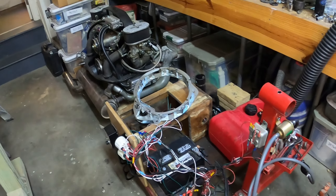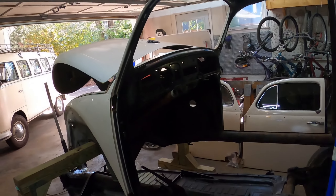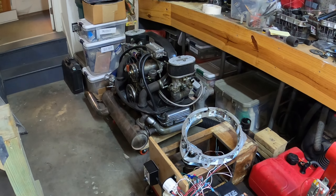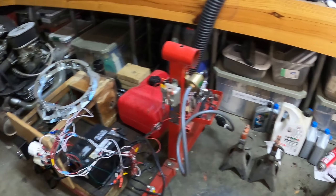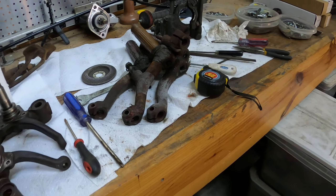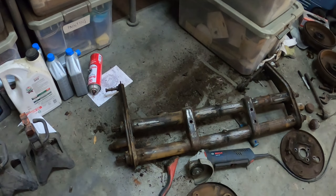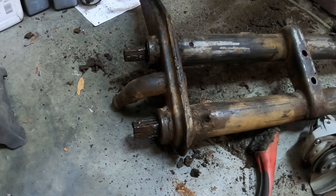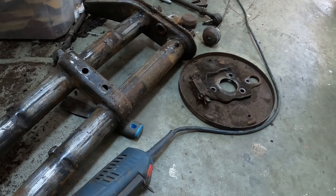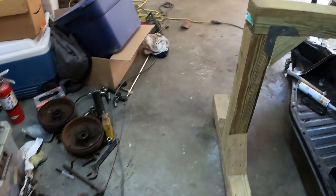I sold my 1300 motor for exactly the amount I bought this 61 body for. Now I have to put the 1968cc motor back up on the stand. I have two new bottom torsion arms coming in today. I've got the spindles cleaned up and I'm working on the front beam - I'm just trying to get a coat of black rust reformer and black gloss on this so I can put it back on the front of the chassis.